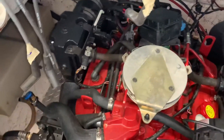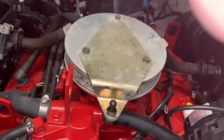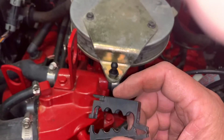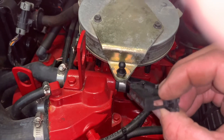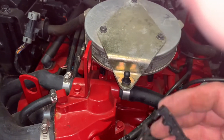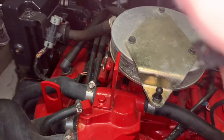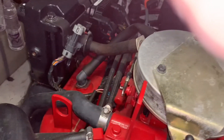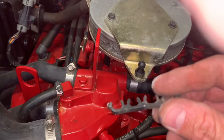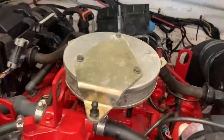I got those out, and then there's a clip — I'll show you guys — it's just a royal pain in the ass to get these out. It's a three-prong clip right here — this bad boy is holding them in. This part slides into the engine mount and sits on it. What I'd say is pull this whole thing off and then unclasp it right here. There's one on each side mounted on the engine, and also on the driver's side there's a little old-fashioned separator as well.